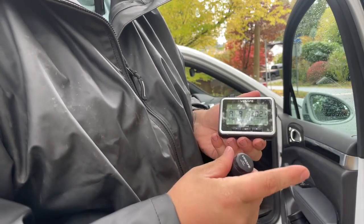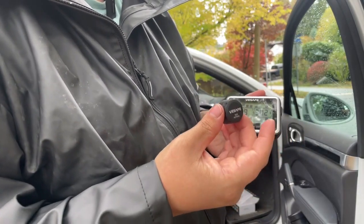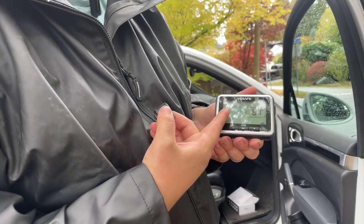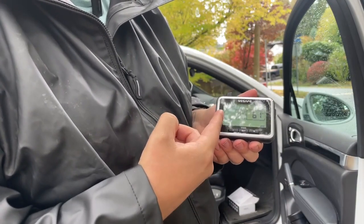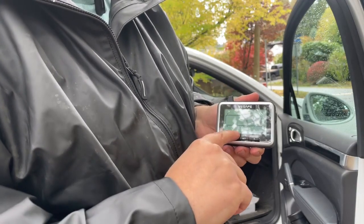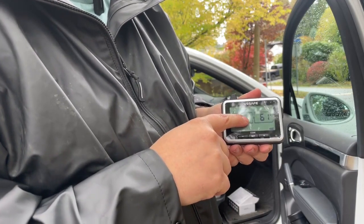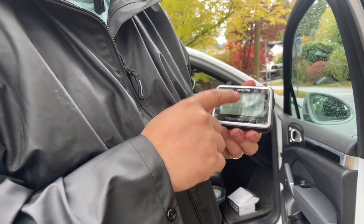Now it's set there. I'm going to save it. It's not on a vehicle right now, so it's showing zero PSI — and it's giving me a warning, beeping at me saying there's no pressure. That's the tone you'll hear for an emergency. Hit Set again and it tells you 'low air pressure' and shows how much is there. It has factory settings you can change — right now it's in bar, but you can switch it over to PSI quite easily.